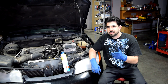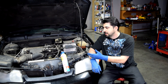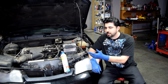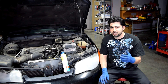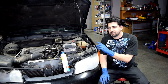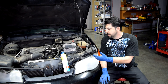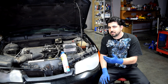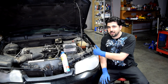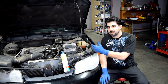Now if you turn on the car and the AC compressor clutch is not engaged, you can start adding refrigerant little by little — maybe add for 10 seconds, then wait a few minutes, see if the clutch engages, then add a little bit more and go from there. If the clutch is not engaging due to low refrigerant, it should start engaging after you add five or six ounces — so maybe after two or three intervals of 10 to 15 seconds of adding refrigerant, you should see it start kicking in. Keep that in mind, because it could be due to other reasons why it's not engaging, so you don't want to add too much. Also, if the system is completely empty, you'll feel the refrigerant going in a lot quicker than if it's half empty or if your problem is something else not related to low refrigerant.